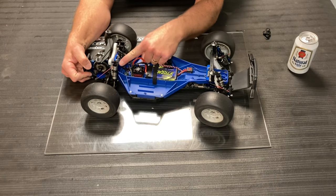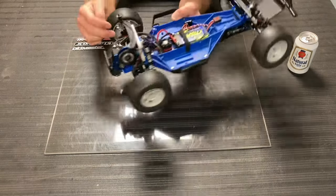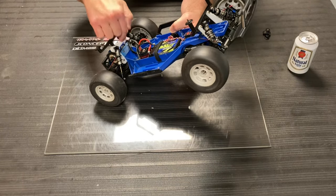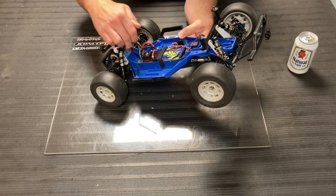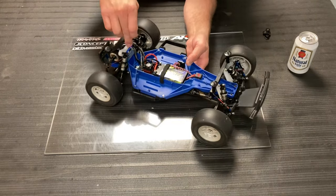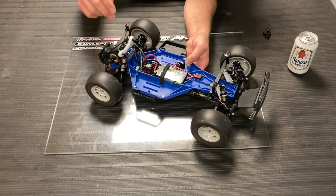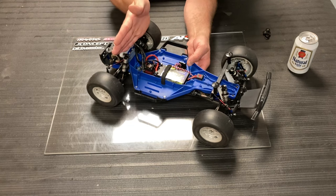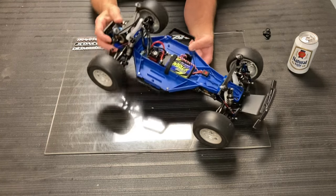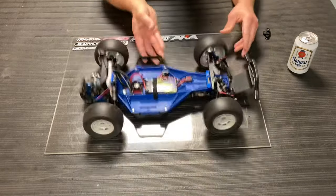Blue piece here, I had to make this special block to mount this shock tower. And the rear sway bar is mounted to the new shock tower I made, but this blue block was kind of tricky to make. There's lots of cuts and angles. It uses the four mounting holes that the stock one does, the vertical holes. And then I had to cut a groove in it to put the white piece in, and there's grooves this way. And it was kind of complex, but it's not real pretty, but it is a prototype and it does work.